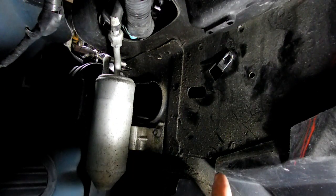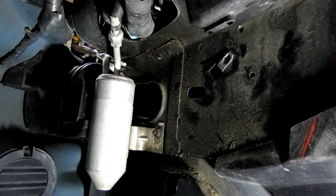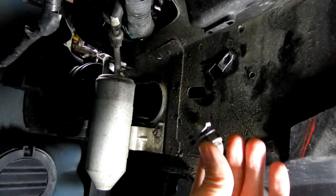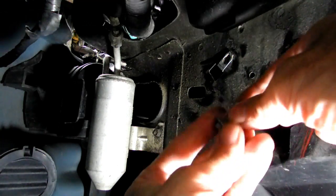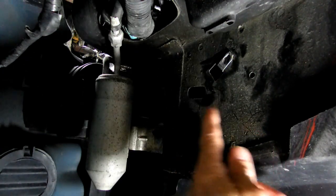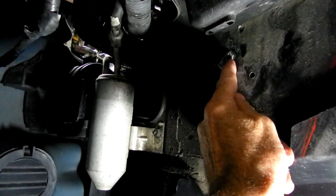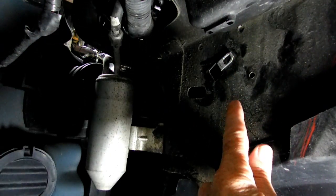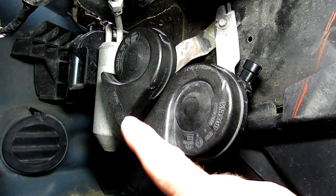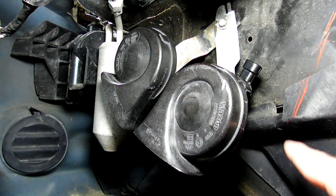Here is the area underneath the front of the fender where we're going to be mounting our horn. You can see the old horn in front of the AC dryer. Remember that piece from the junkyard — the bolt and the captive nut? It goes right into this little window, with a little hole right next to it, and it fits right in there. Here's what the horns look like all mounted: the forward horn is very close to the AC dryer, and we have good clearance.